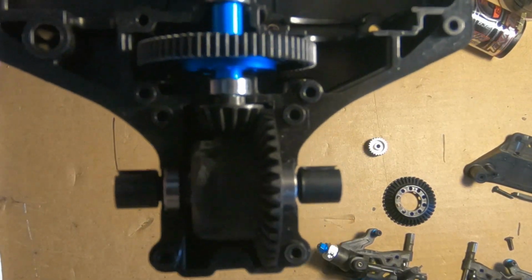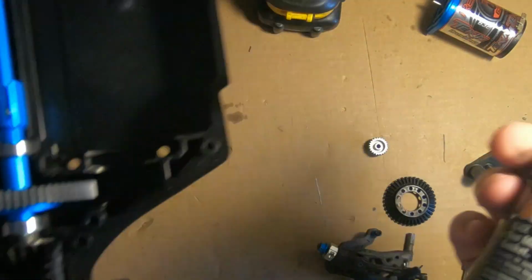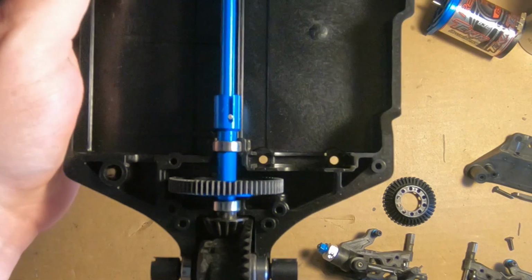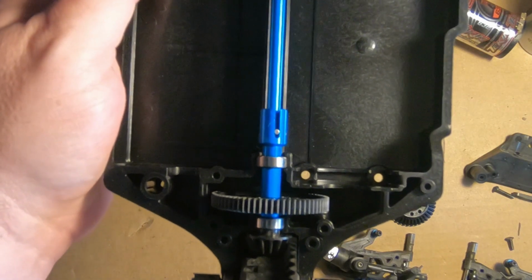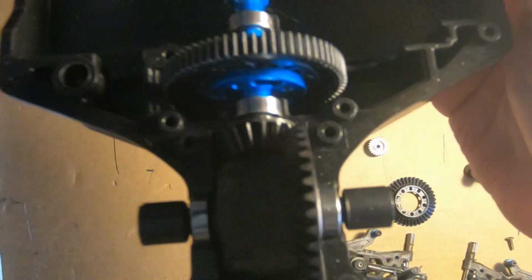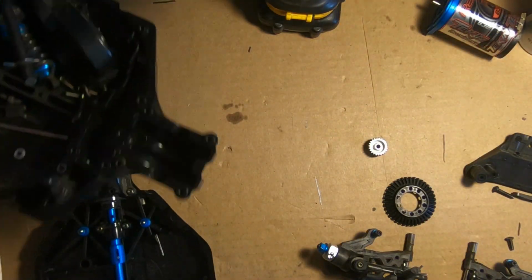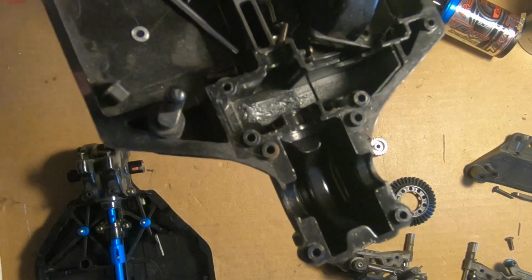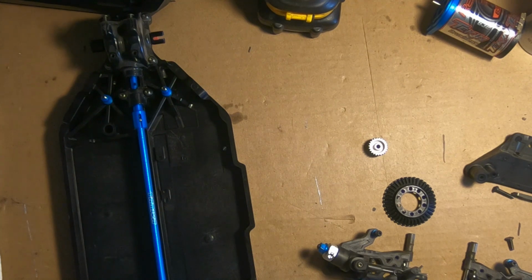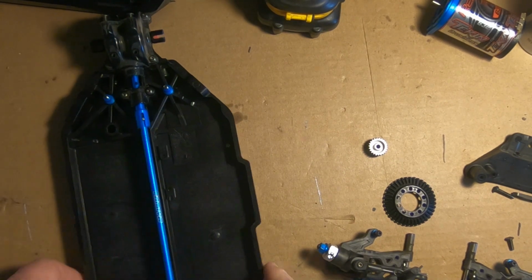Okay, rear diff is rebuilt, and I sealed around the gasket with some Permatex Right Stuff. It's not the really hard stuff, the gray stuff that we used on aluminum to aluminum pans and blocks back in the shop, but it'll work to seal it, because I actually had a leak. I don't know if you can see it, but there's oil in there, so the gasket wasn't torn, so I don't know, but that's done. Just washed the cover off. I gotta wait for it to dry so I can put it back on, and then I can continue with the build.